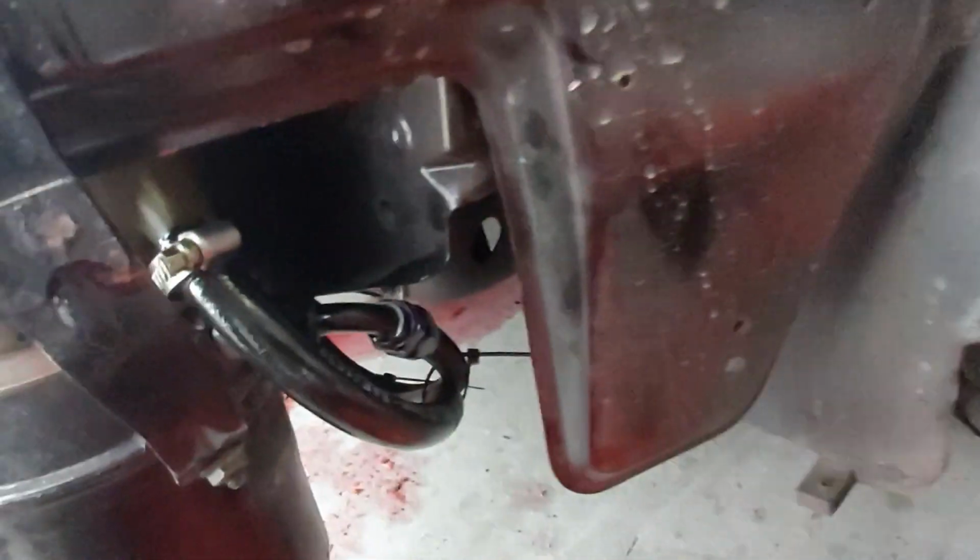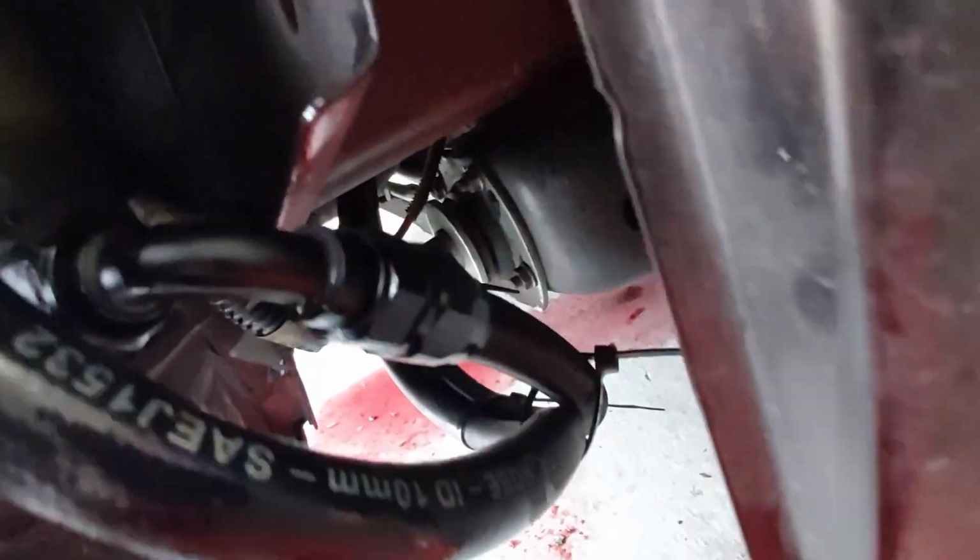And we've got the dash 6, I want to say, high pressure feed that comes through underneath the body of the car and up to where the pump used to be. So these are all Aeroflow fittings, runs into the feed down here. Now power, there's an 80 amp inline fuse there. Everything's all insulated, it's not going to ground.